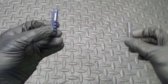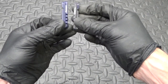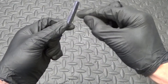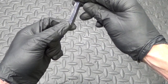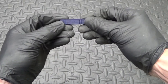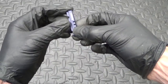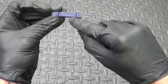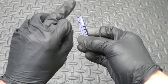Comparing the removed pad to the new one — there's hardly anything left on it. These have a wear marker on the underside with a line marked 'wear limit', and these pads were right on that line, which is why they're being changed. When fitting new pads, many have an arrow or left/right marking on them indicating the correct direction. These have 'left' written on the back and an arrow pointing forward in the direction they need to slide in.